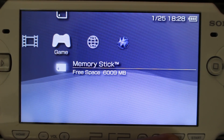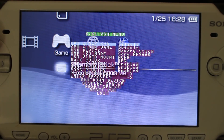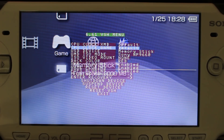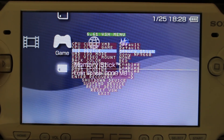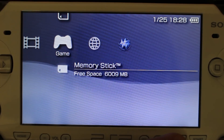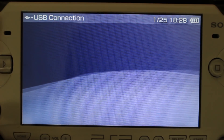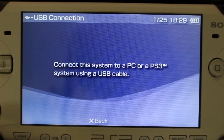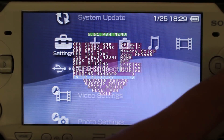For additional tips: press the Select button at your XMB to bring up the VSH menu. You can change the clock speed for your XMB to improve loading, or increase the clock speed for games as well. Under USB Device it is set to Memory Stick by default, but if you want to rip UMD games, change it to UMD Disc, exit, pop in your UMD, go to USB Connection, hook up a USB cable to your computer, and it will show your game in ISO format so you can rip it directly from the disc.